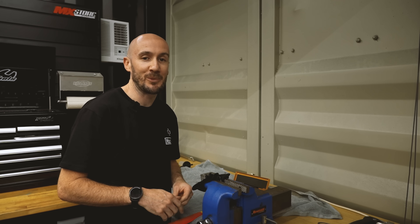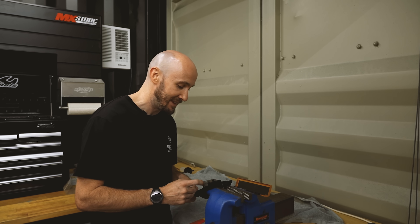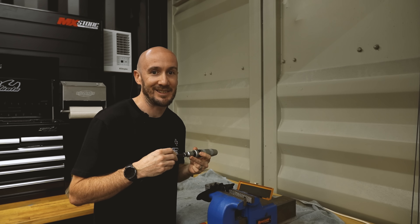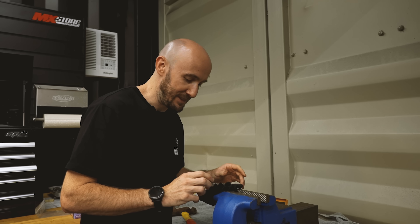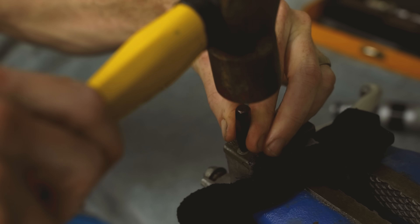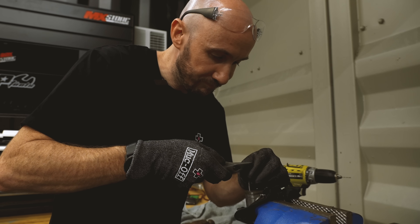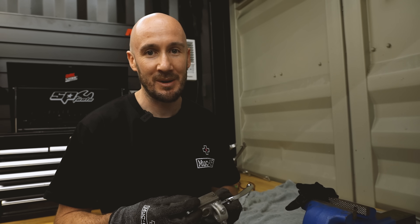Sydney's going to put the front brakes on. Turns out we've got a bit of damage to the top master cylinder — all the screws are rounded out and seized. I'm going to try and get it out without having to drill it using this impact driver — that'll help crack the seal and get the nut out. The first one is good but the second one's really damaged. I had to modify the screw to get some grip and ultimately had to get the drill to it, but we managed to break the seal and get it done.